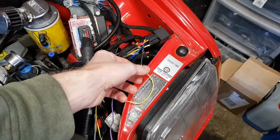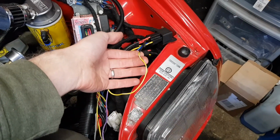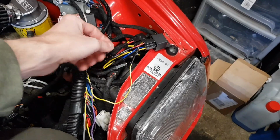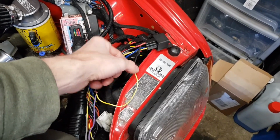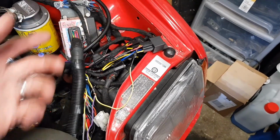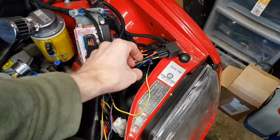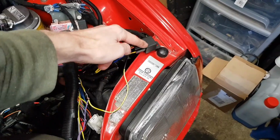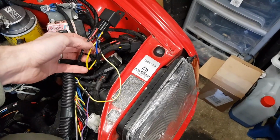And then all this trigger switch literally is either off your ignition, or in my case it was supposed to be off my ECU, or some other method or switch. All it does is effectively go, right, turn that on, and then it lets the power go to the thing you're doing. It just means you're not overloading, because you only need a really light power wire now to turn this on and off, and then you can just do it directly from the battery.